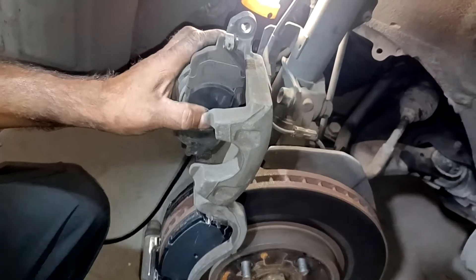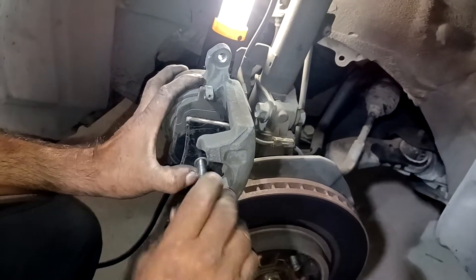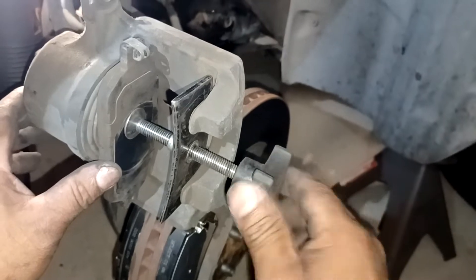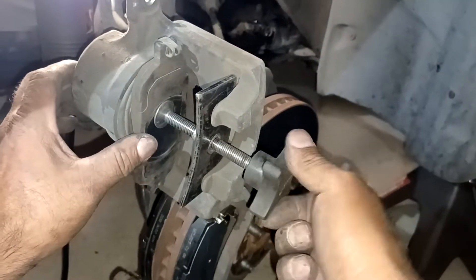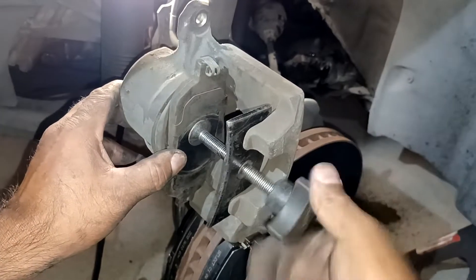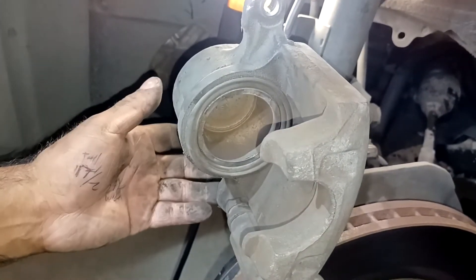Here we go — last part: the caliper. First things first — put a brake pad right there, then put the brake caliper tool right here and start pushing back. As you can see, it's got a gap still in there so you've got to start pushing it all the way back. Make sure on the caliper it goes all the way. Put one of your old brakes across like this — it's very easy instead of struggling. Just go ahead and put the old brake on there and start pushing back. See how it goes in very easy, gently. There you go — now it's all the way through.